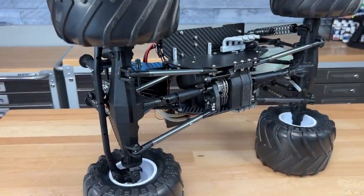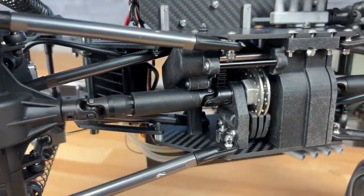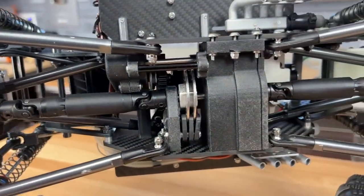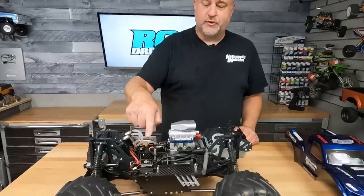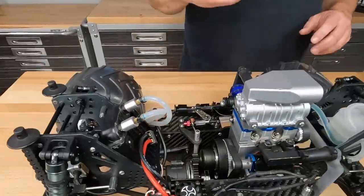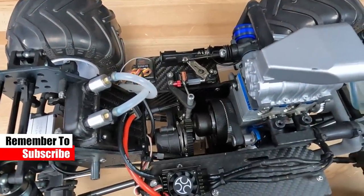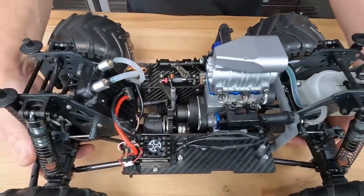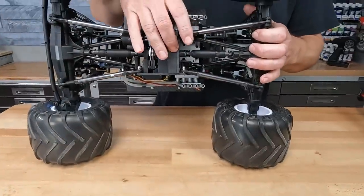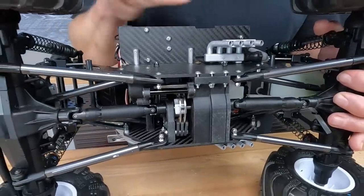Now let's talk about the transmission. These engines don't rev high, so I had to come up with a custom gear ratio for the truck to make it work properly. I didn't want to buy a transmission because it might not have the right gear ratio. So I just designed the whole transmission. The transfer case in this case — because of the low revs of the four-stroke engine — actually gears up, unlike a lot of transfer cases that gear it down. That gears up to get me more speed, and then it connects underneath to another transmission housing that has a Traxxas Revo two-speed in it, so that'll get me even more speed down the road and I can adjust shift points.